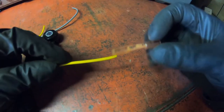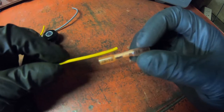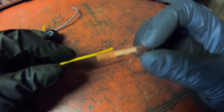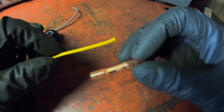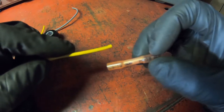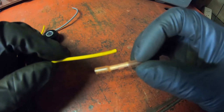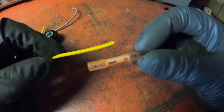To get the wires together I'm actually going to use a heat shrink butt connector. These work really good and should keep out the corrosion. Over time sometimes these do go bad and you have to replace them, but for the most part they work really well. The disadvantage of soldering is if you put too much solder on, the contact's not going to be that good — so using a metal crimp of some sort might be more helpful. But for this I'm just going to use this.